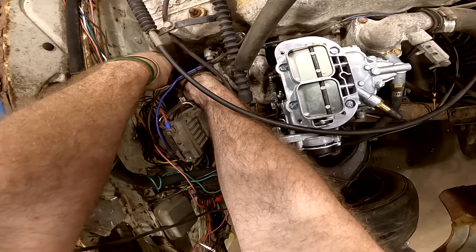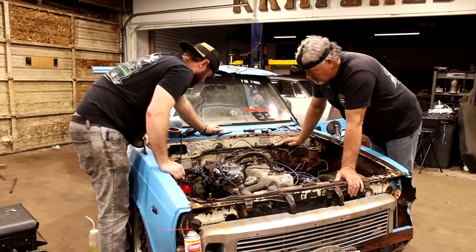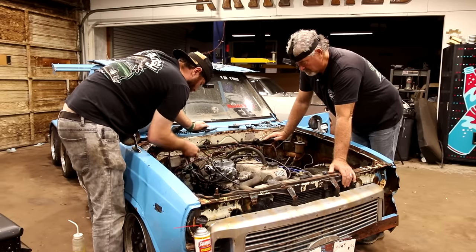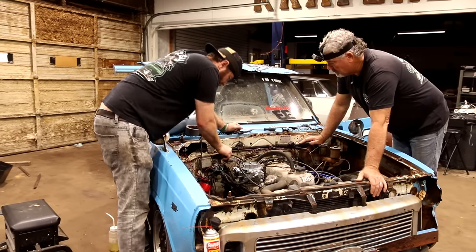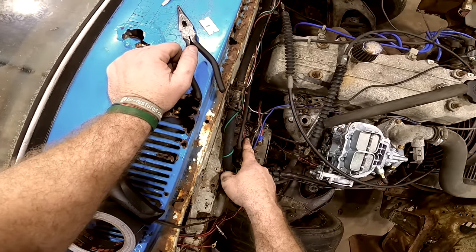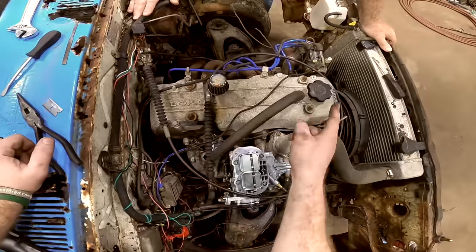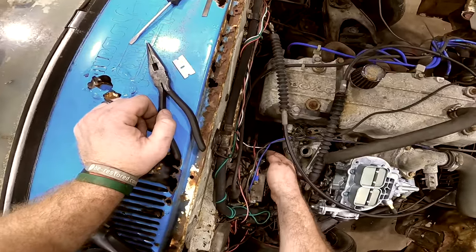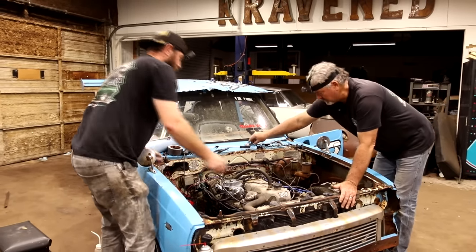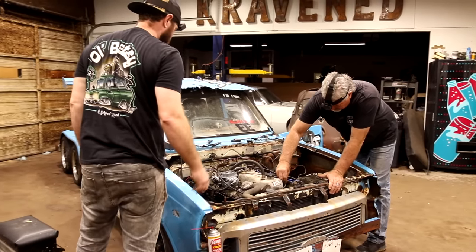Plug in this little condenser. I think the only thing left is the spark plug wire that runs to the distributor. I think that's it. We've got our hot coming in from the switch. Comes off here on the negative side into our igniter. And then the wire comes out of the igniter to the distributor. And then we've also got our wire that runs down to the little condenser down there. Is that tight? Yeah, got it tightened in just a second, but I'll double check. Here's a wrench if you want it. I guess we'll hook a battery on it and see what it does now.